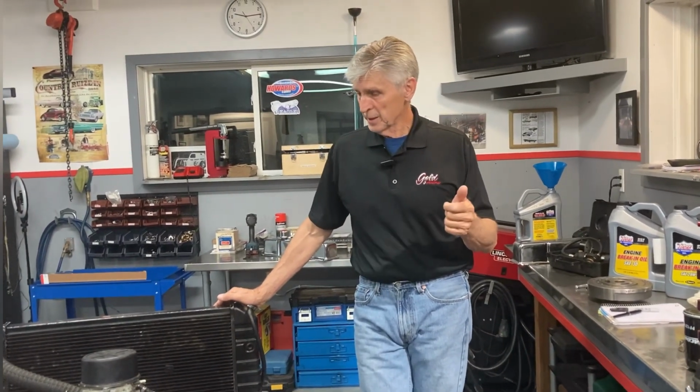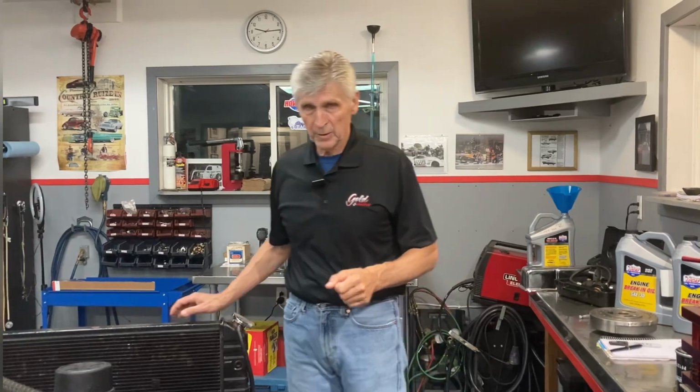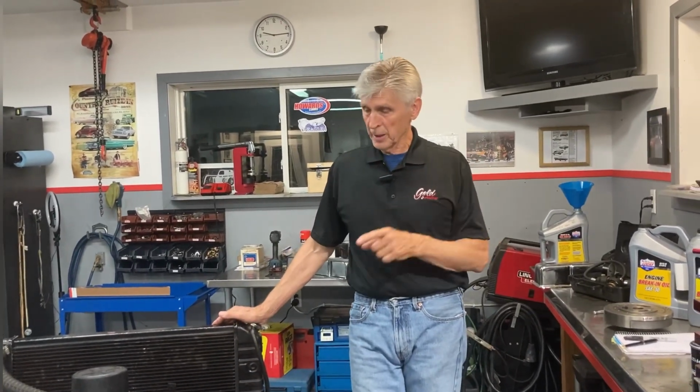That viewer asked me if we could dyno the engine with a 2-barrel carburetor, because they require the use of a 500 CFM 2-barrel carburetor. And of course, the racing that I do here in Canada, we also use a 500 CFM carburetor. We have 3 of them. So I'm going to bring one of them to the dyno with me, and I'm going to try to make at least 1 or 2 pulls with a 500 carburetor.